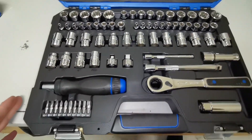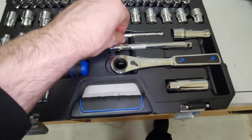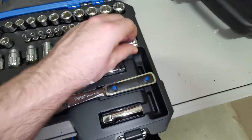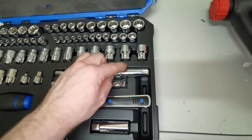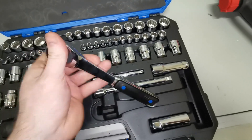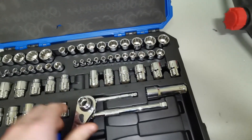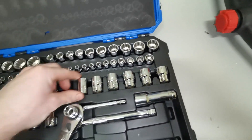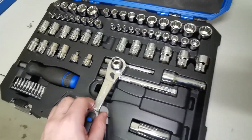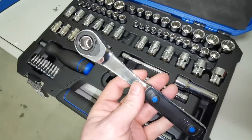It's a pretty extensive kit with a wide range of items — a bit driver, bits, a quarter inch, three-eighths, and half inch drive. The sump plug I believe is a 13mm, so that'll be my setup. It has six-point sockets which is what I wanted — I'm not the biggest fan of 12-point, but you have both options: 12-point in the three-eighths and six-point in the others. It also comes with adapters to change from quarter to three-eighths, making it a multi-function kit.